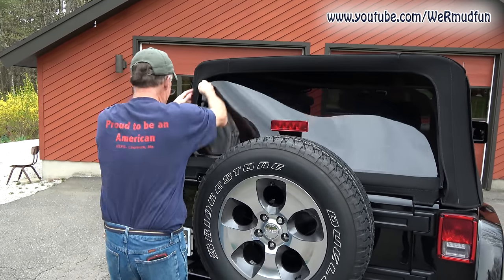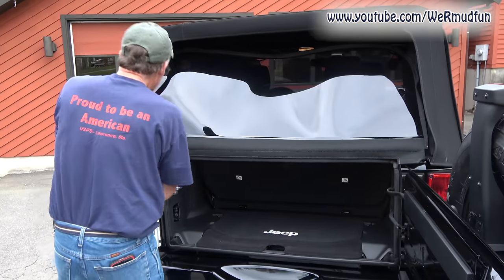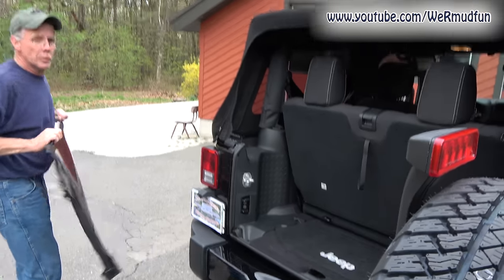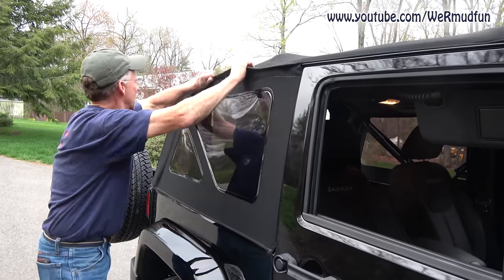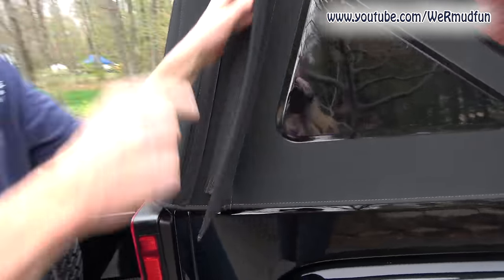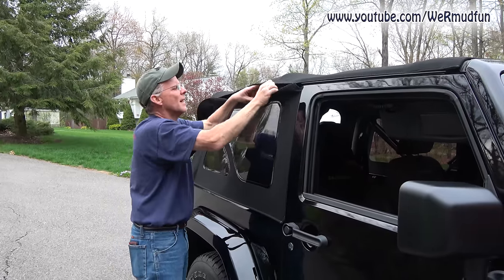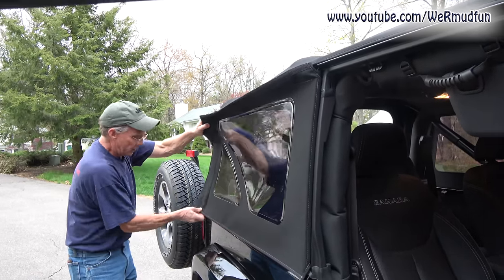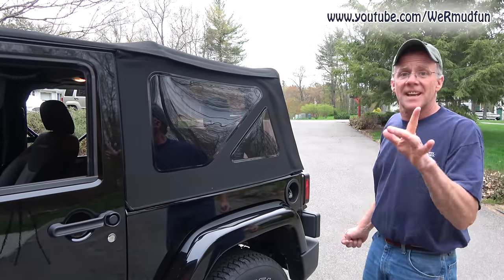Open the tailgate, disconnect, disconnect, and roll it. Simply unzip it, take it out, and put it someplace safe. You do not want to fold this — folding would be bad. To take the quarter windows out, the zipper is always down here when the windows are in. Start here to take it off — up and around we go. Once it's off, open the door and do a simple pull down on the bottom for the body retainer, then come out of the door retainer. Window is out. Exact same thing with the driver's side quarter window, then right out of the door retainer.